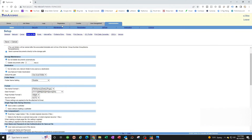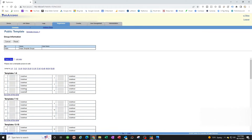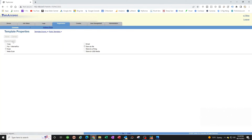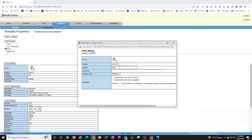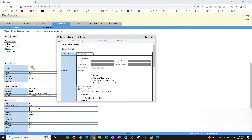Next, go to Registration, then select Public Templates — it should be empty on your end. Click on the first box and click Scan — it automatically sets the agent to Scan as File. Under Panel Settings, enter the name you want displayed on the copier's screen when you walk up to it, such as 'Scan to Me.' Hit Save.